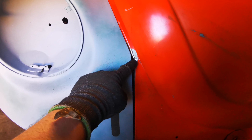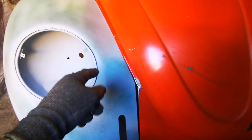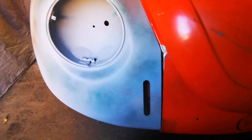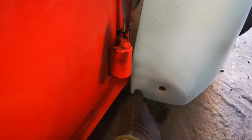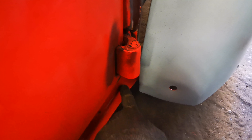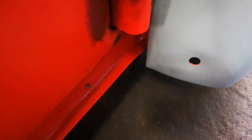Where this point is, it doesn't quite sit into there where the apron comes down. It's almost like this whole wing needs to fall forward a bit, so I might try to elongate some of the holes so I can adjust it a little bit more to help it fit better. Also, when I'm putting the new heater channel in, it's fouling against that which isn't allowing me to bring it in up to the body. I've got a repair to make here so I won't do anything beforehand, but I'm thinking I'll just cut this down - there's quite a big lip on there - cut out a bit on that corner to get it to fit better.